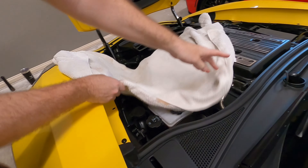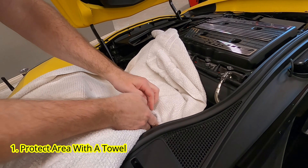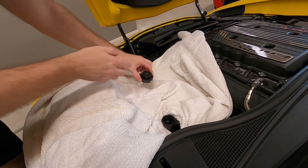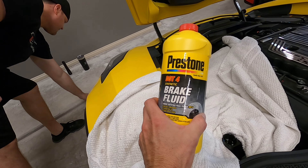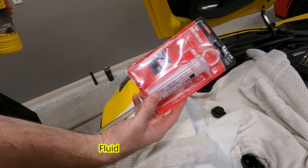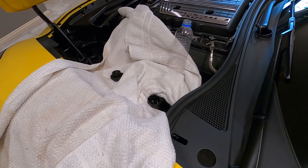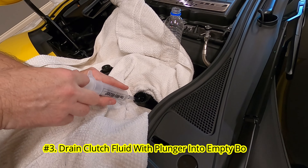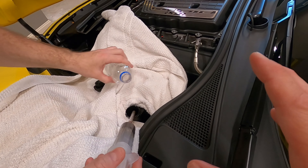The first thing we're going to do is cover the car with a towel to prevent any of the brake fluid from getting on the car, because it's very corrosive and you definitely do not want that on your paint. The next thing you're going to need is DOT4 synthetic brake fluid, and the third thing you're going to need is a plunger — we will link both of these products from Amazon in the description. The next step is to drain the clutch fluid from here into this water bottle. It's not a hard process, but you're probably going to have to do it anywhere from six to ten times to get it thoroughly clean.